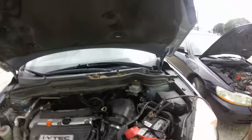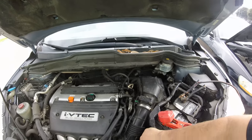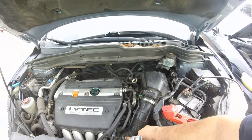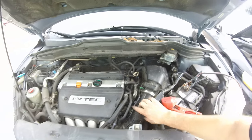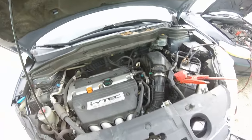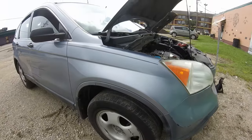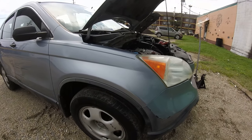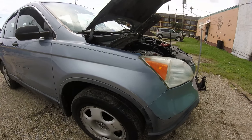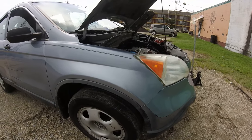What we did here to start the checks is opened up the intake, took this intake neck off, and made sure there was no water in the intake — which there wasn't. We were getting a clicking on the starter, so the next thing we did was pull the tire off and made sure the engine was freed up, because the starter may actually be engaging and the motor is locked from getting water in it. We verified that and it was good.